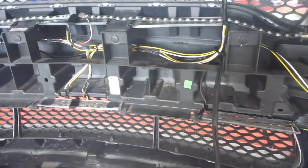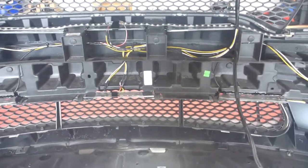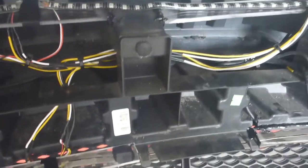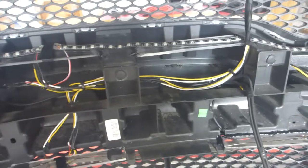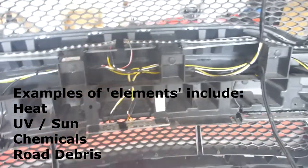We've got a lot of wires running around here — they're loosely zip tied together. However, you can see that I didn't loom them or decorate them. If someone is going to pay me to do that, if I quote seven hours for this job, then I can go back and loom everything. This is purely a cost and time decision. I under-quoted, but even if I had quoted appropriately, this will never be seen — literally even if you raise the hood. Loom has two purposes: aesthetics, and protection against abrasion. That is not a factor here. We're drilling through plastic, this is not a dangerous situation, and these wires are tucked and hidden away inside the bumper cover.